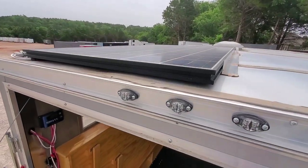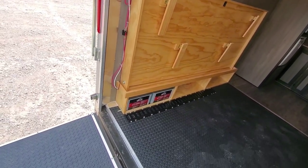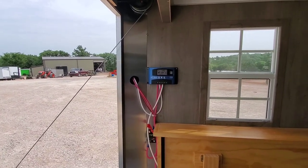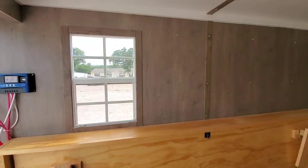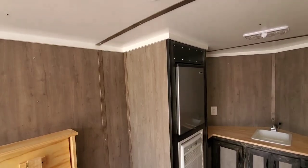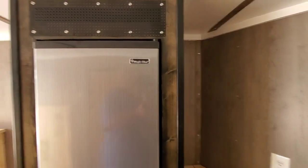On the roof of the trailer there's a 250 watt solar panel, and that solar panel is powering two 95 amp hour AGM batteries. There's a 30 amp MPPT charge controller that feeds the batteries and keeps the charge up on them. We put the solar panel on strictly to run the refrigerator, which is a 2.4 cubic foot household refrigerator, but is actually as if not more efficient than the more expensive 12 volt refrigerators. The refrigerator can run on solar or shore power.